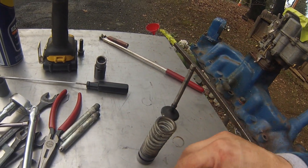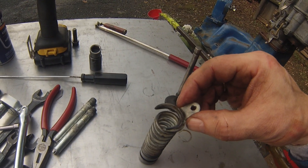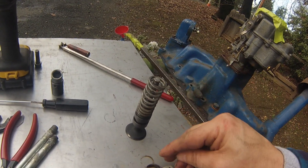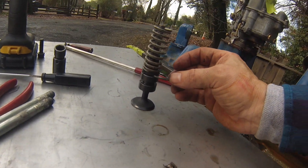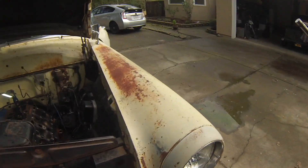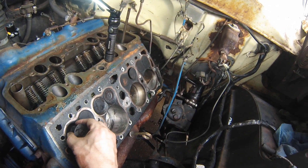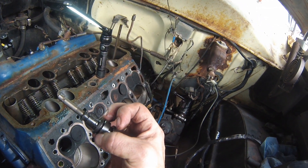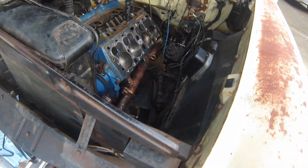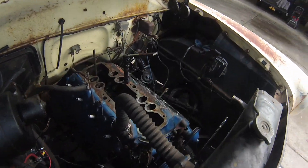The valve has got the leaning tower of Pisa going on — it's bent. This is how the thing's kept in there: you've got the spring, you have a retainer that goes right there. I stored mine in the exhaust manifold, so that'll have to come off to get that. Once the spring's compressed and the valve is down over it, the piece goes on there and then the keepers go on, and this goes into that groove and holds the whole kit and caboodle in. You can have it all pre-assembled on the bench, then just slide the whole shebang in, put that clip on, and bada bing — it's in. Fairly easy, depending on who you are. Anyway, I need a valve — that's coming. Doesn't look too bad inside there though.